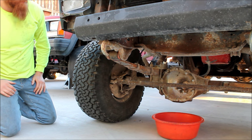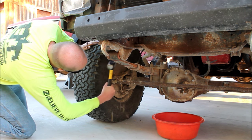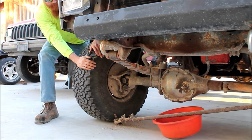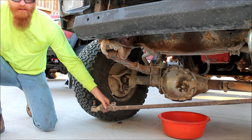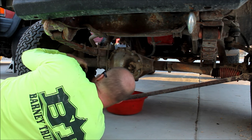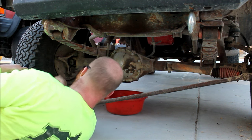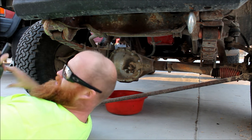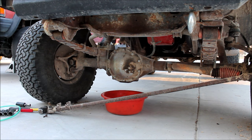So the first thing we're doing is getting the tie rod out of the way. We'll use a ball joint puller and pop that right out — just whack the knuckle and it'll pop out. Somebody siliconed chrome acorns on top of the bolts, so now it's stuck inside my socket. It's not that stuck, just me shoving an extension up inside. This will take longer than expected.